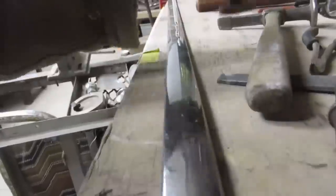Okay, at this point that kink in it is now the biggest problem, so I'm going to try to push that down and put that extra metal in the dent there that's right beside it. So we're going to be tapping down on that, pushing up here, just like a smaller version of any old fender repair. Nice thing about this is you can hide a little ripple, or you can hide a little imperfection. It's just get rid of the huge dent.